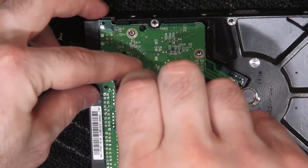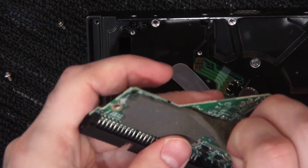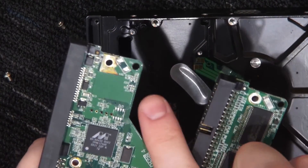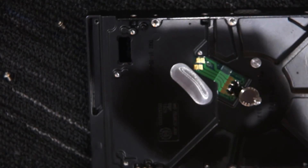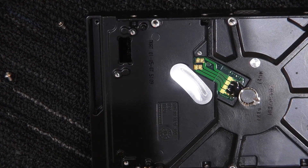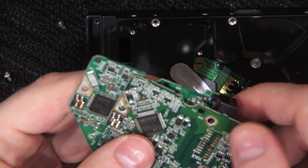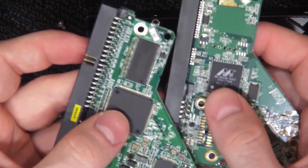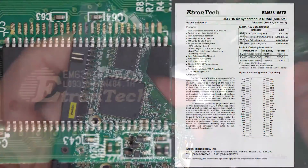Let's take off the logic board here — it comes off with just slightly sticky foam once again. Quite a big difference. We're talking about an older interface: we can see they've opted to remove a fuse, and there are entirely different chips. The ST smooth, which must be the motor driver, is very similar although the packages look slightly different sizes — it's a 3.0 versus a 2.2, so slightly different model numbers. This switch is identical; we're missing the fuse or similar device. This one requires two drivers — the main drivers basically went from QFP to some sort of BGA-type package.